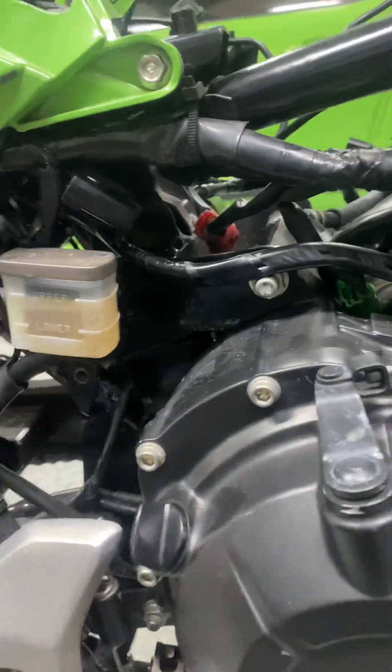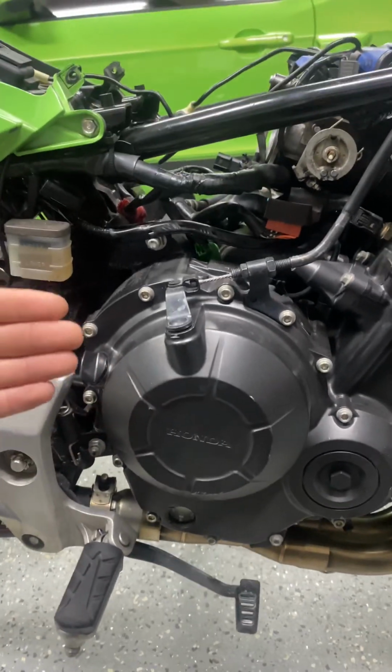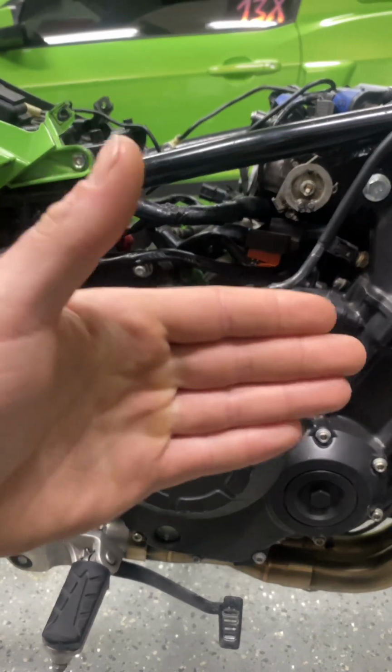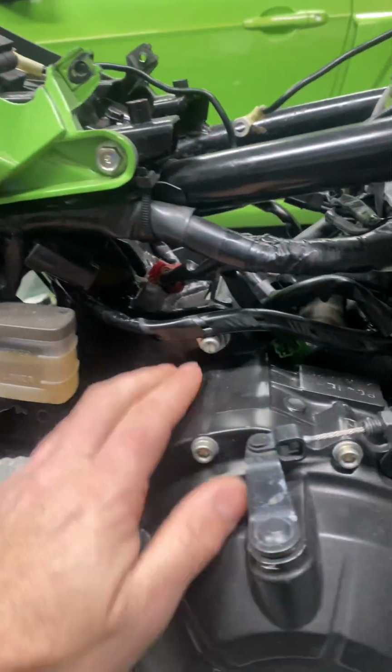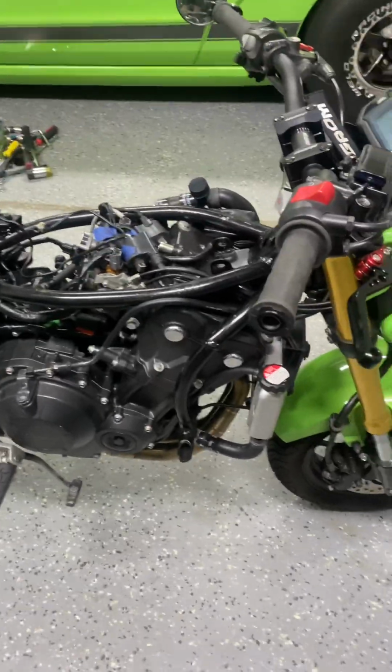Same with the top. I actually just bent a little plate steel that went from the inside of the frame rail, bent out, and then went around the actual mounts on the engine. And then this is braced and gusseted inside and below it. So those are the 4 mounts to get it in there.